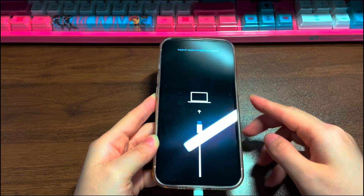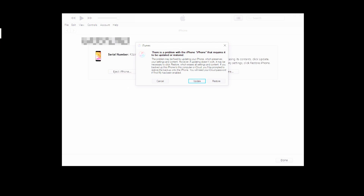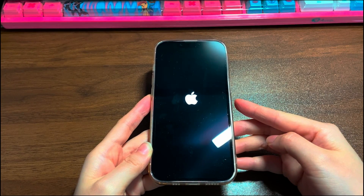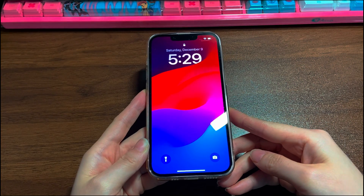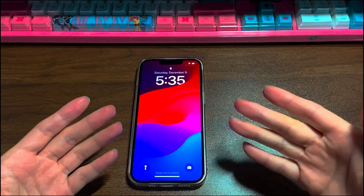Go to your computer screen, and iTunes or Finder will quickly detect your device and prompt you to update or restore your device. The update option aims to install an update on your device. The restore option aims to wipe clean the device. Let's go with the update option first. Finish the on-screen instructions and wait. iTunes or Finder will then download and install the healthy iOS software into your device. Installing the latest iOS can help fix a black screen on iPhone 13 without losing any data. Hopefully your iPhone 13 restarts and turns back on successfully.